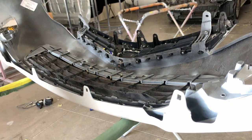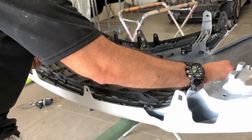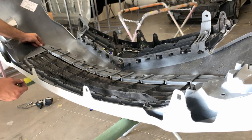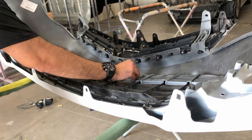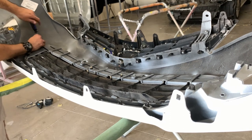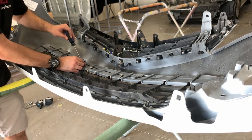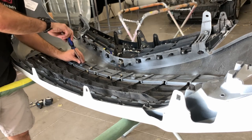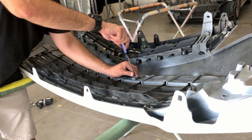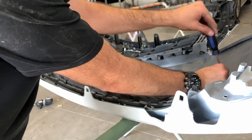Be careful. So now we're going to get those screws in there — just three of them, one on each end. If you don't have all the screws or you're missing screws, it's okay — you can buy these at Ace Hardware or something. You really only need two of them on each end and that'll hold it in pretty well, and then you've got two in the middle. A lot of people ask us why aren't you using an impact gun — because it's faster, yes it is. More importantly, you have steel screws going into a plastic part. If you screw it in too hard with the impact gun or use too much torque, it can crack the plastic. So that's why I recommend just doing it with your hands — just twist it in there. It's easier that way.